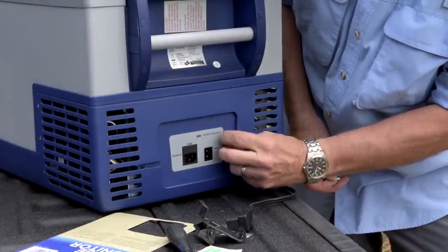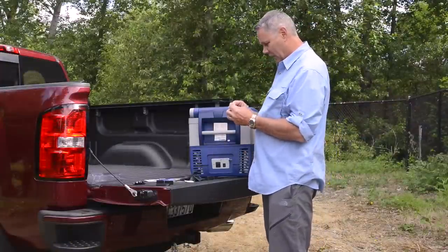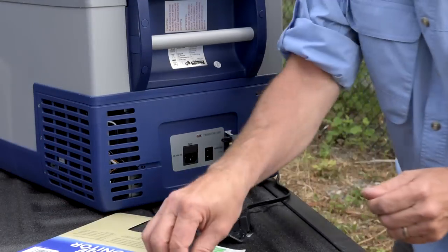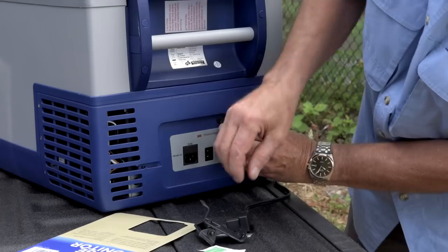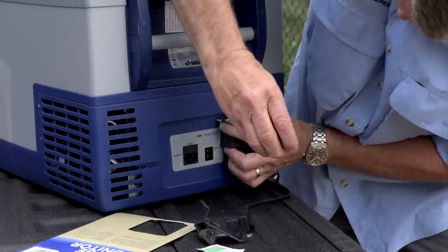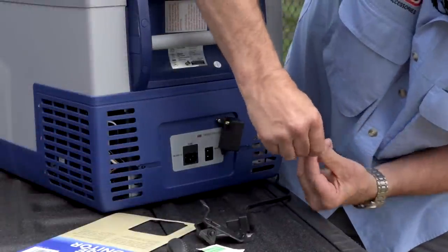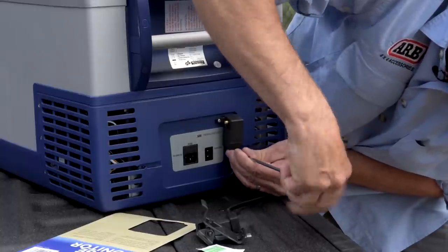Here we have this little grommet on the back — we're going to pull that back and you can see there are several pins in here. Here we have the sending unit. We're going to plug that into the brain of the refrigerator — we have our multi-pin connector there, just stick it in the back. I use a little screwdriver just to give it a nudge to make sure it goes home. We're good there. Tuck things away and then we have our Phillips head screws which will just fit right in that hole. They're self-tapping screws, so very easy to install.